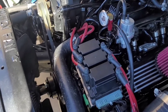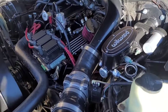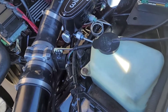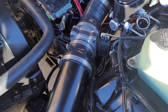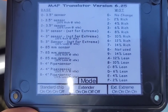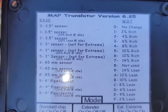I'm about to make adjustments to the coilovers, but I noticed the car was running a little rich at idle. I made some adjustments to my mass airflow translator. I have the Turbo Tweaks chip, so my settings are configured for a non-extended chip. I had it running 10% rich at idle because I have a 3-inch mass airflow sensor. Now I'm going to set it to 10% lean at idle because I was getting a little bit of smoke.